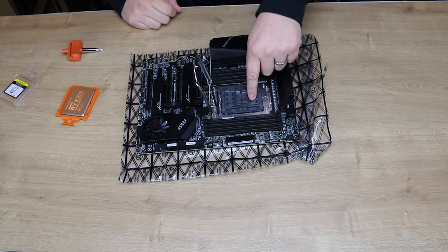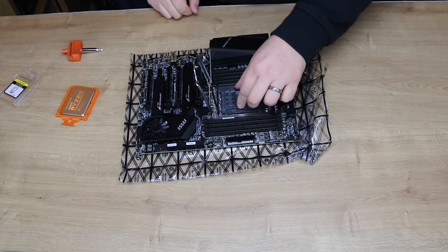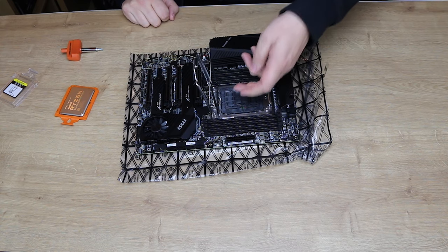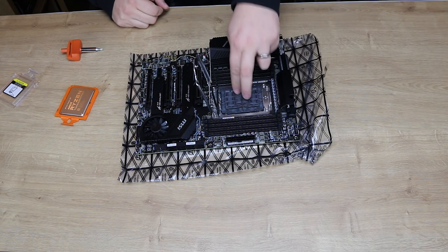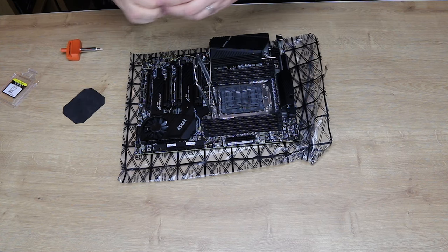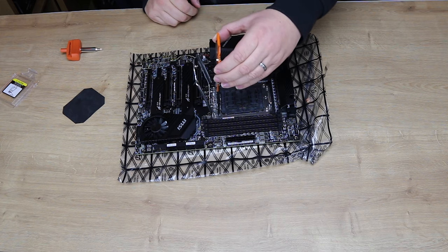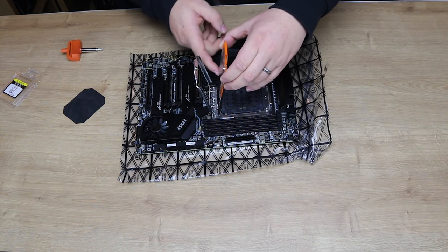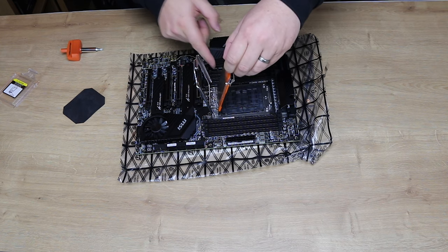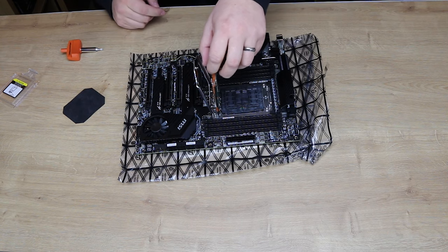There's also another plastic tray to protect the pins. I'm going to leave that on until I put the CPU in — that way, if we drop the CPU, it's not going to damage the pins underneath. Some people take that out first, but personally I prefer to get the CPU and then slide it in. It's like two little runners that it runs on, and it runs down and clips in — and then it's in. That CPU is now in the socket.